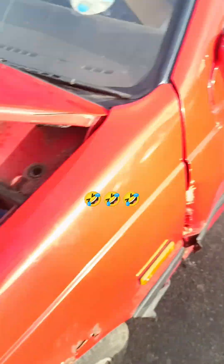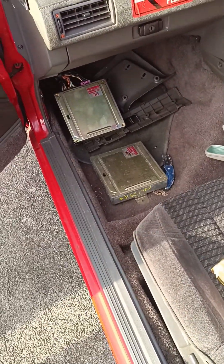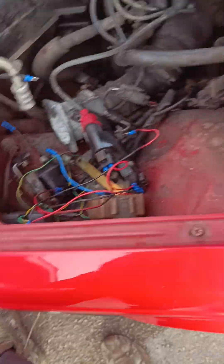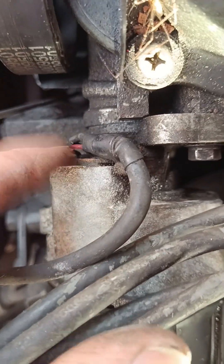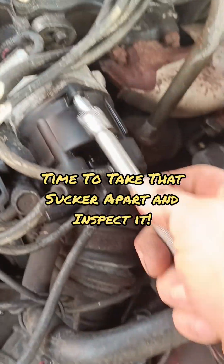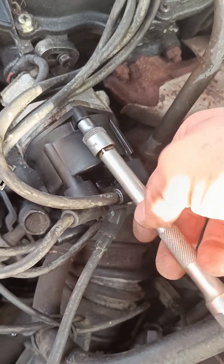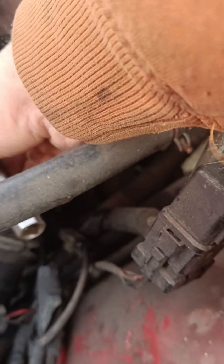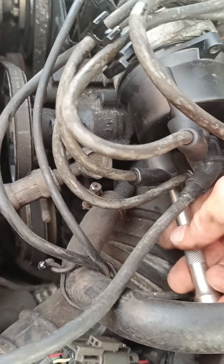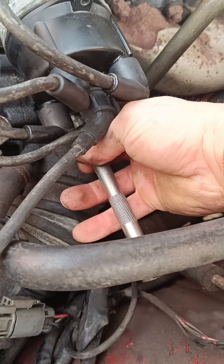All the earths are cleaned. Tried both ECUs - still the same issue. I doubt both are bad. I reckon it's going to have something to do with the distributor sending a signal telling the injectors to fire. I reckon it's probably something to do with this little module on the back - maybe a corroded wire or something. I'll take this off and have a look, clean that earth up on there as well. Everything else has been changed, there's nothing else it could be.